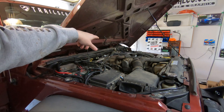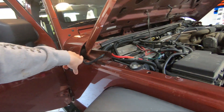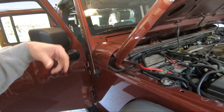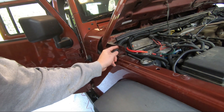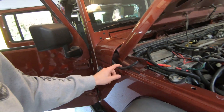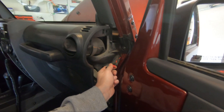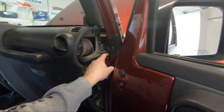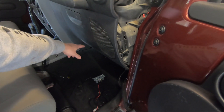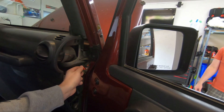I'm looking at the best way to route the wire. There are a few options — on the automatic there's actually a huge hole in the firewall on the driver's side since there's no clutch pedal hole. Both cowls also have little holes through them; if nothing has been run through before, there's probably some foam in there you just jam out with a screwdriver. The previous owner has already nicely routed a power wire through a grommet, and we can probably use that same path. On the other side there's nothing connected, so we can use that hole — it's a really convenient spot since we're mounting the CB base unit right there.